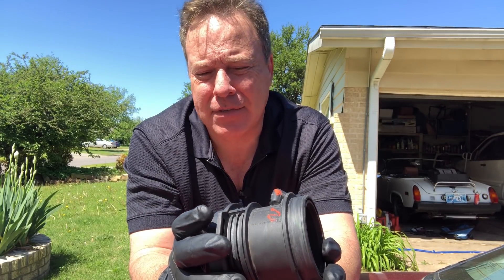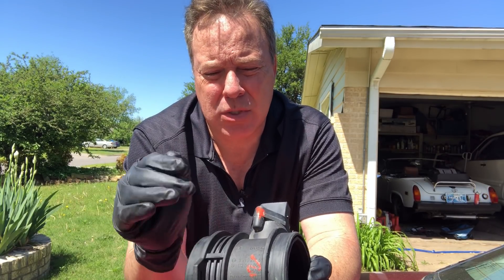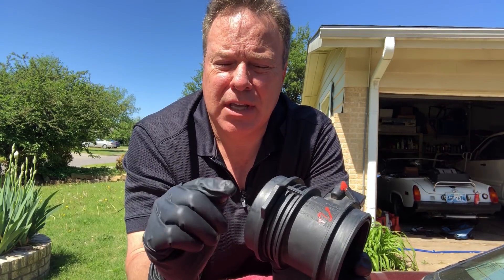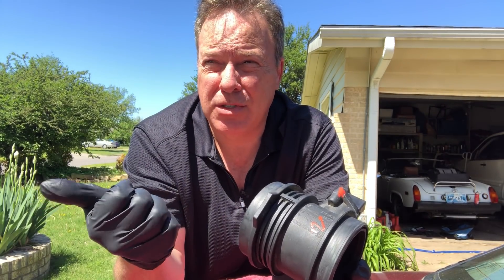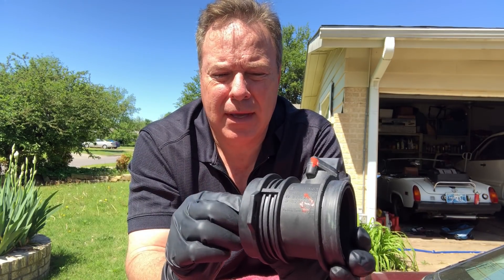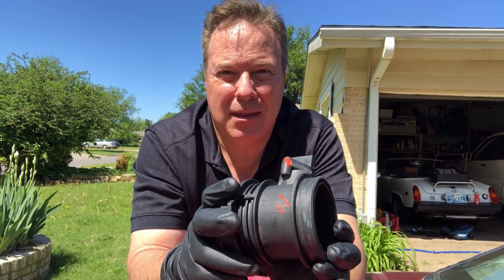I've read and talked to other people — you want to stick with OEM. So this is what came with the car; this is a Bosch, so I bought another Bosch sensor. A lot of folks will change this first before they go into checking for fuel and spark. This is like $150. My time — call me cheap or whatever — but I would rather do something inexpensive first. And then you know you are getting spark, your spark plugs are good, you are getting fuel, your fuel injectors are good. Then you can go ahead and change this and you're two steps ahead of the game.